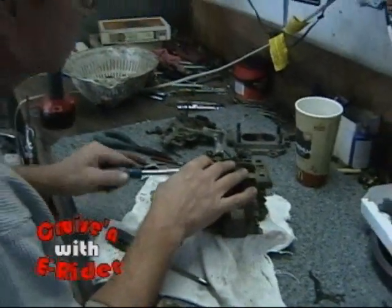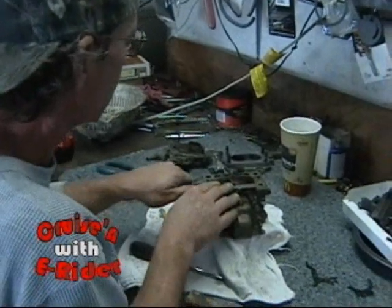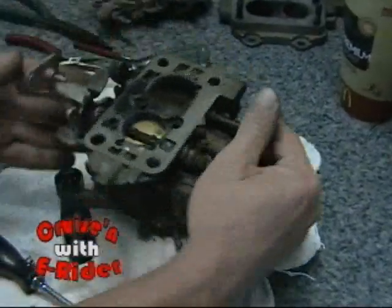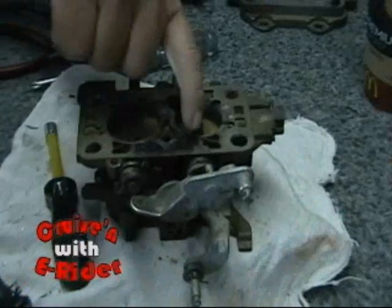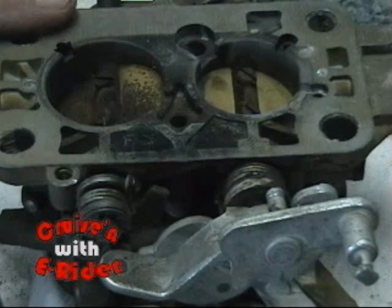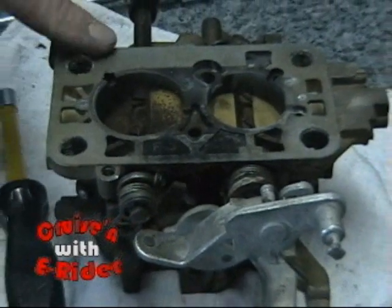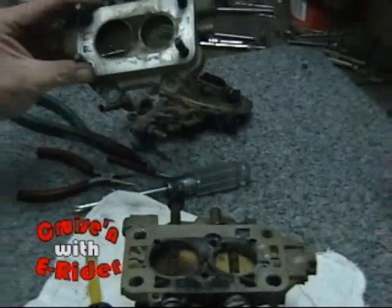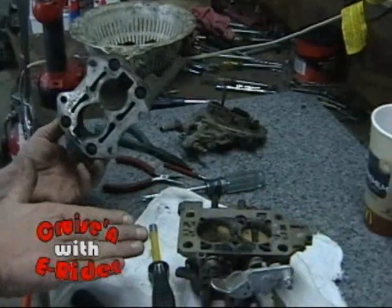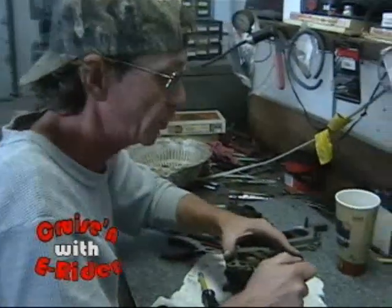Them junkyards are not known for keeping their parts very well, and we was trying to save something from the junkyard, and that requires a certain amount of work. If you look right there and see that black, it means the gasket wasn't sealing like it was sealing the rest of the way around. Warped. That's why I wanted you to bring in this spacer. I'll beat them studs out and we'll surface both sides of that spacer and the bottom of that plate. That way, when we bolt the darn thing on, we know everything's good. It's going to hold air anyway.